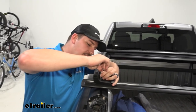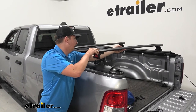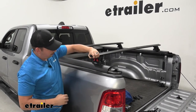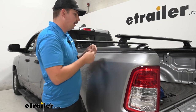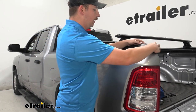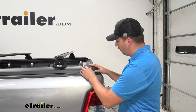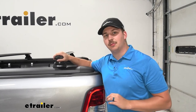We can then fully tighten everything down. At that point, everything should be lined up and tightened down, so it's as simple as dropping it back in and pulling out on those red locking tabs. Verify that they're all engaged — we don't want to forget to lock up the legs. On our mountaintop cover, install the caps on the rails, lock up those legs, and slide on the end caps. Everything's ready for our accessories.